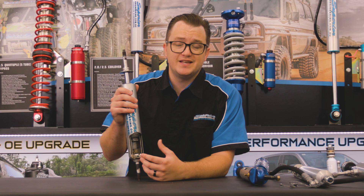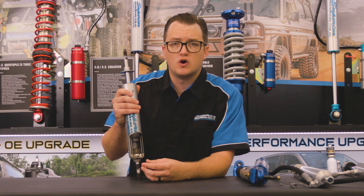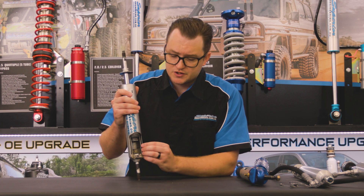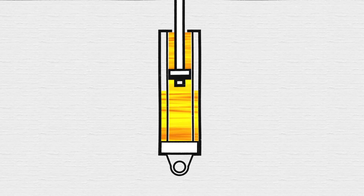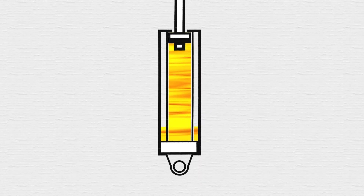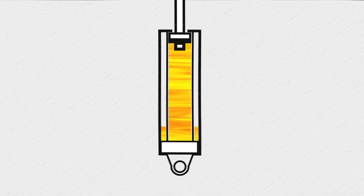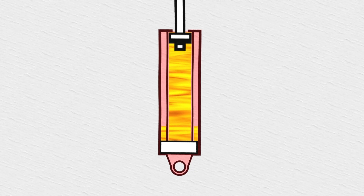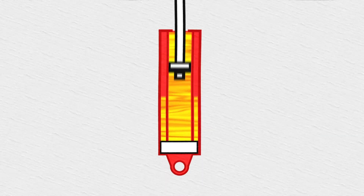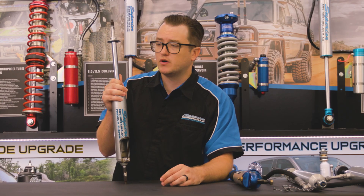The unfortunate letdown of these is by design. If you plan on getting into touring and that sort of driving where you're spending a lot of time on corrugated roads, this design being a twin tube and having no physical barrier between that oil and nitrogen can cause these two to mix, thinning out the oil, aerating the oil, and stopping it from doing its job of passing through your shims. It makes for a much rougher ride and you can get shock fade where the shocks really start to heat up and the ride control just isn't there.